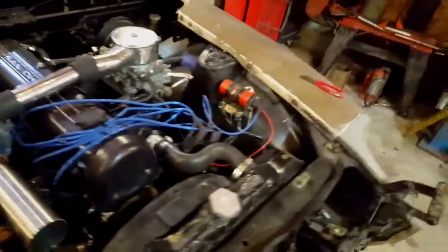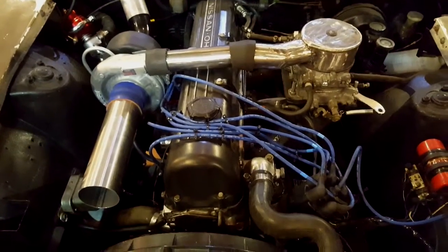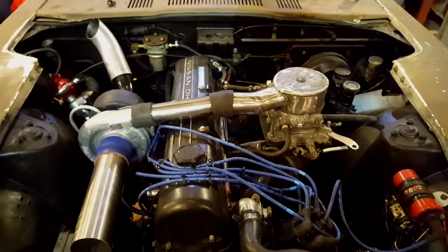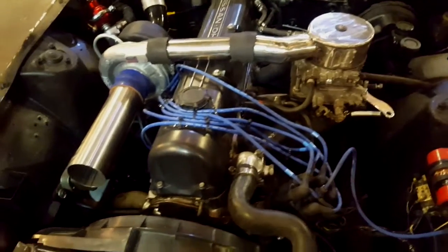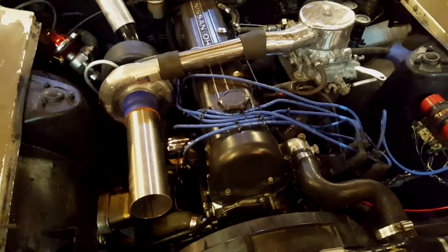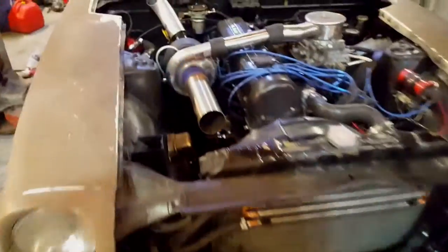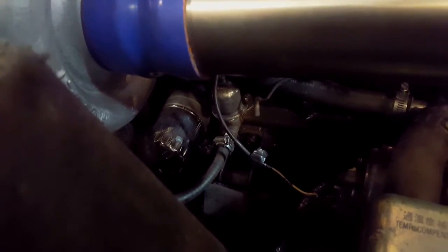People mentioned that routing the exhaust manifold around the oil pan could cause high oil temperatures, which is very possible. This car is completely experimental and I have no idea what it's going to do when we throw boost through it. I wrapped the exhaust with heat wrap to lessen heat issues and try to drop the temperature. I also put an oil cooler on the front here, routed in through the oil filter with lines that come around and go out to the cooler. The turbo oil feed lines come straight off the pressure sensor — I put a T in there so the sensor still works.